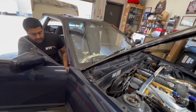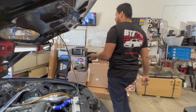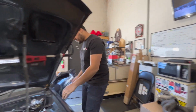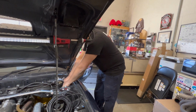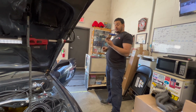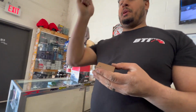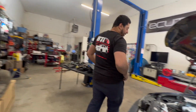Regardless of what you do with the switch, if you pull off the timer, it stops working all the time, but then you don't have any of the low speed function, and they don't retract back to the home condition. Where can you get one of those? Good old eBay. So you can run wipers without this box, but they don't return to home by themselves. You've got to shut them off when they get back to the home position, which is annoying. But we at least know what the problem is. He just needs one more. Yeah, that's good.